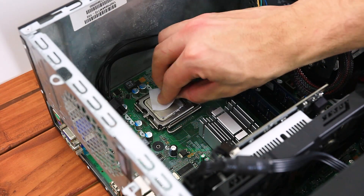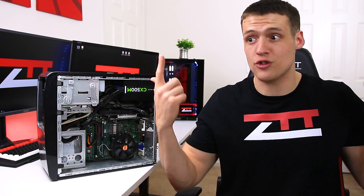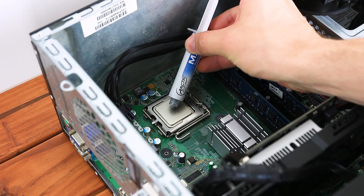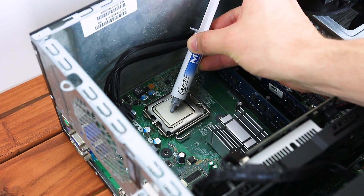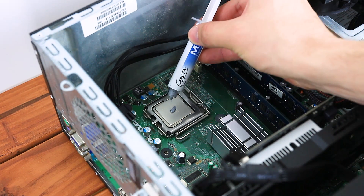I then started to wipe away all that gunk with my alcohol pads. I tried to get this process done as fast as I possibly could, that way the ambient temperature in the room stayed the same and that wasn't an extra factor. The new thermal paste I'm applying is the Arctic MX4, which is what I always use for gaming PC builds — link is down in the description — but this does introduce another factor into our mix.